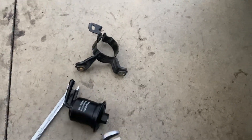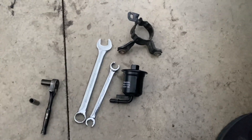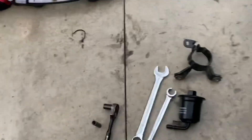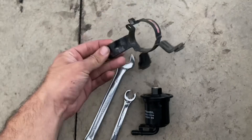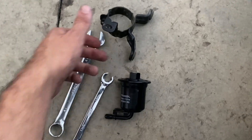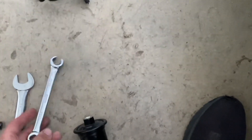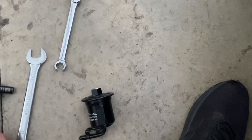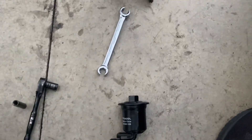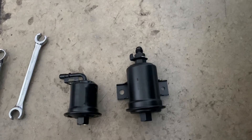This is a new filter but I'm not going to use it — I actually bought it like two years ago talking about replacing my fuel filter and never got to it. Anyway, what I did was knock off the two small bolts and there's an 8mm that clamps the filter into the housing. I removed it completely so it was free-floating, threw the 14mm on the actual line fitting and the 19mm around the housing, held the 14 in place, and spun the housing around because that thing was stuck.